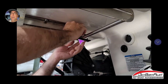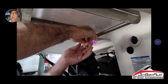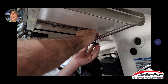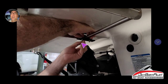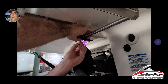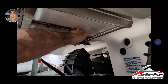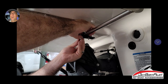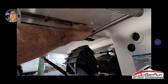Now we're going to take our bolt and pass it through. While we're holding the part up, take the second bolt and pass it through the back side — it's a little easier if you put your hand around the back side. Now, while holding it up, put on the 5/8 washer, then the lock washer, then add Loctite to the lock nut. Just be careful as you thread this on — make sure it threads up nice and easy. Do not cross thread. Finger tight for now.